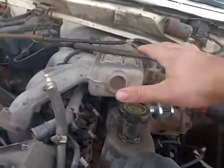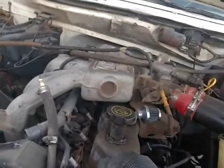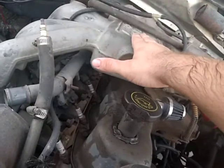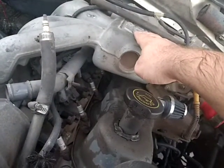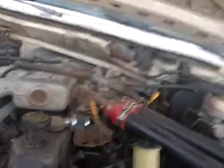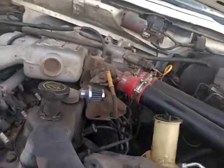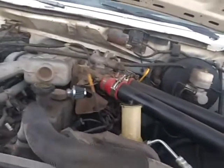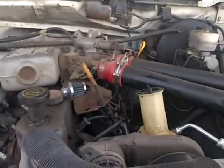The way I'll be doing this is, rather than having this entire plenum and contraption and everything, I'm going to mill this all out. I'm going to take this off and turn this into a water-to-air intercooler — however you call it. I'm going to take advantage of the freeze plugs as well, on both sides. Delete the EGR and all that, and I'll put in a 460 or something, throttle body — something much, much bigger. That way, it can handle the boost.